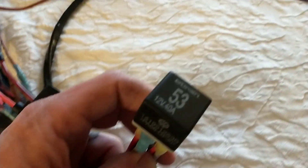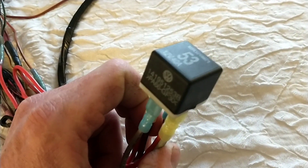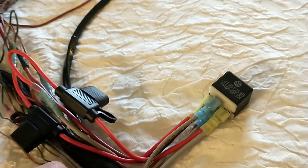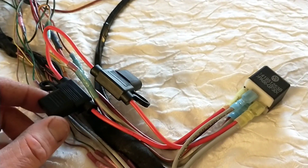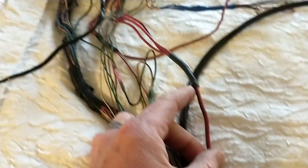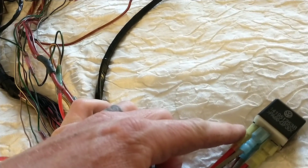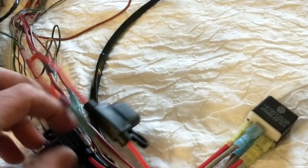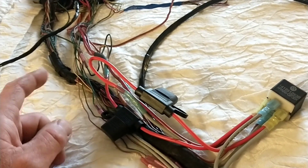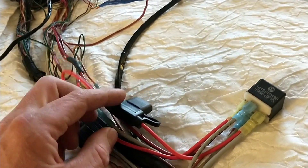This is a type-53 relay — I just reuse it out of the car — but an 87 relay would be the same thing. These Volkswagen ones are a little stronger; I prefer using those over a cheap 87 relay off the internet. Basically, you've got your three power wires coming from the ECU, and those are going to run to your main power feed from the relay as well as that 15-amp fuse that is jumpered to all the other power wires, so that's going to feed all your power once the key is turned on.